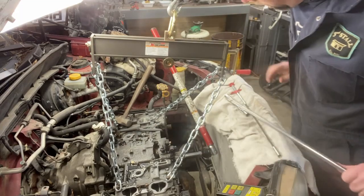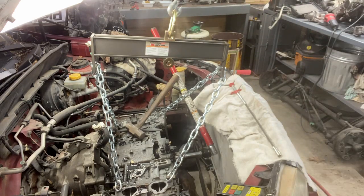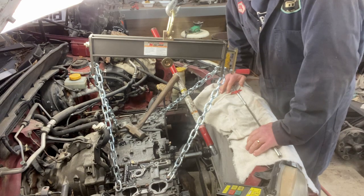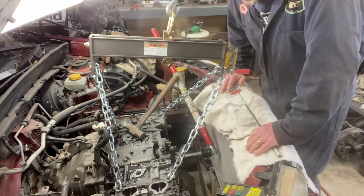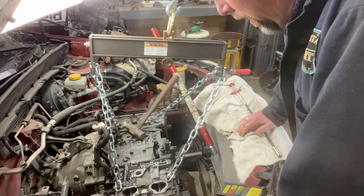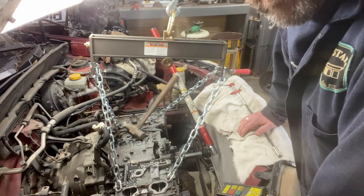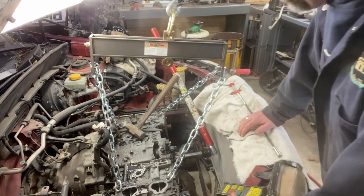All right, so a little time has passed, and I decided to call in the phone a friend feature and called a buddy of mine. And said, here's the situation, what the heck do I do? I gotta get the engine to turn to get it out. I can't get it to turn. His suggestion was start dismantling it from the bottom side. So we're going to drain the oil. I think the oil's still in there. And drop the oil pan and take some of those interior brackets and baffles out and see if there's a way for us to start taking the caps off the connecting rods and see if we can see something that's wedging it, or beat on it with a sledgehammer or something, to figure out what we need to do to get this rotating assembly to become a rotating assembly again instead of a non-rotating assembly. So let's start on the bottom.